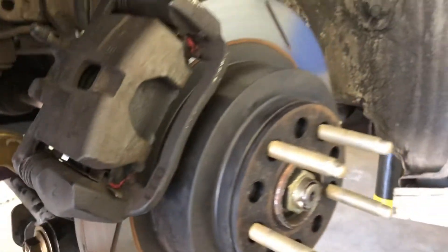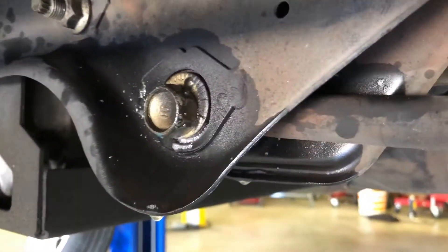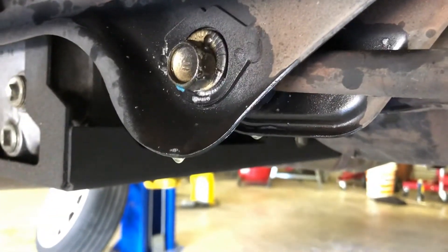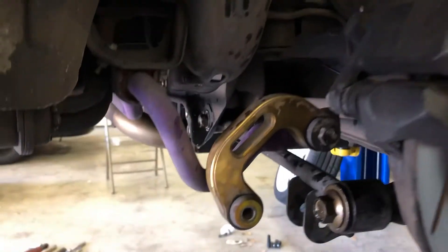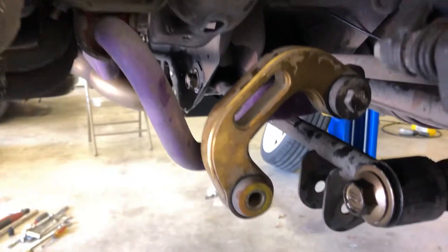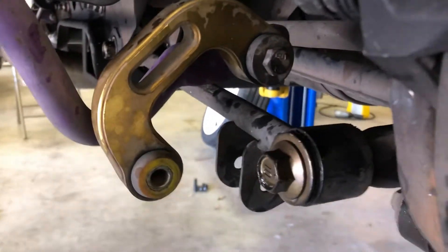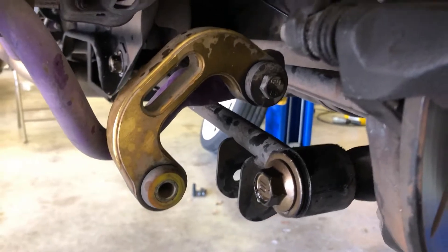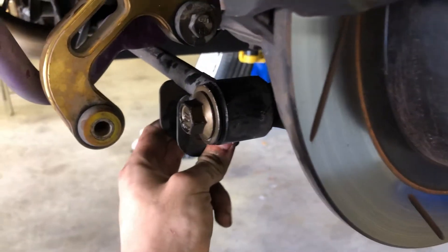Now that we've got the wheel and tire off, you can see in here I already went a little happy with the WD-40 — making sure not to get any on the brake rotor, that's very important. You'll notice I don't have dust shields because I'm running the H6 caliper conversion on the back. Back here is your toe adjustment — it pulls the tire in or out. You'll want to eyeball or mark the position to preserve your alignment as much as possible.